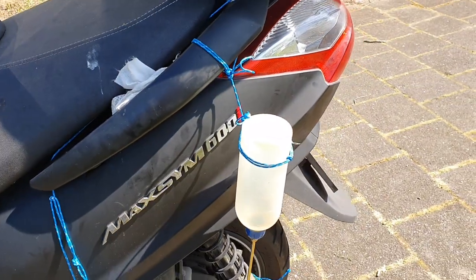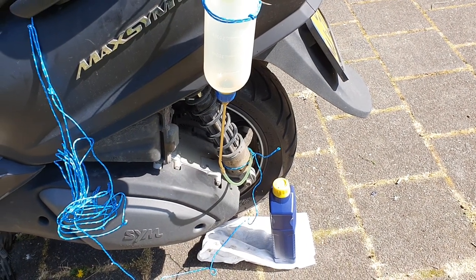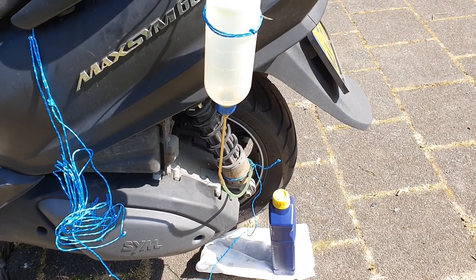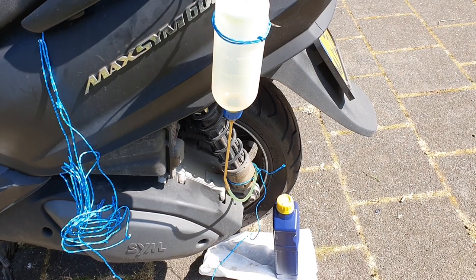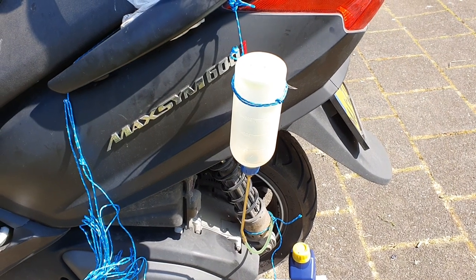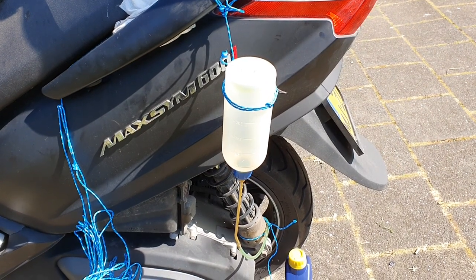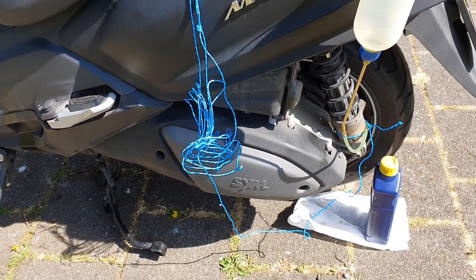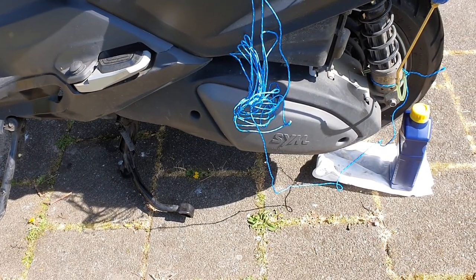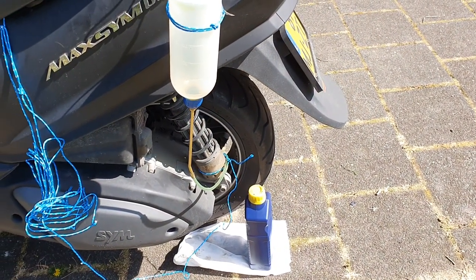I'm very happy with this — it's easy enough, it just takes a long time. This transmission oil has been dripping for certainly one hour, possibly one and a half. So my recommendation: start with the transmission oil first, then do the engine oil which takes a lot less time. Fix things like the center stand bracket along the way.